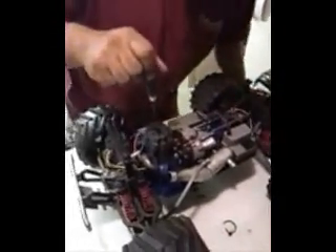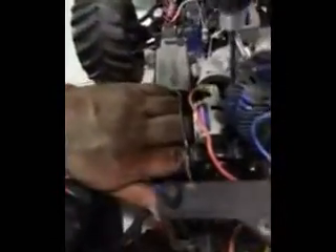Pull that baby out — there's two on this side. Stick it in there, take this one out, and there's one more. Sometimes it's a little tricky to get in. You can pull the easy-start motor just a very little bit just to get your little tool in there, and you pull this screw out.